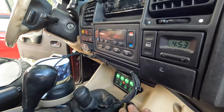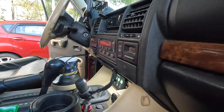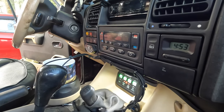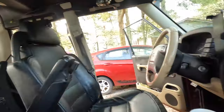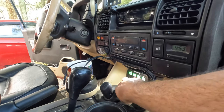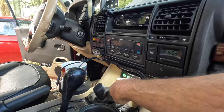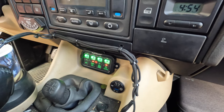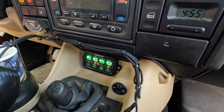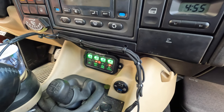The first thing I did is I installed a little map light up here on the center console to add a bit of light inside the truck running off the accessory battery. I also wired my rock lights into the aux beam, and wired in some rear cargo area lights which I'll show you in a second. I've got that wired up to an accessory circuit I'm not using yet, but I have power running to the back so if I want to tie something in it's already set up. The aux beam control panel is mounted right here in the center console - doesn't interfere with the transfer case shifter, and the wire is tucked up underneath the console, nice and clean.